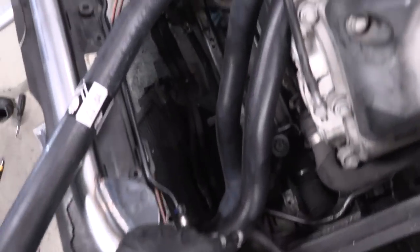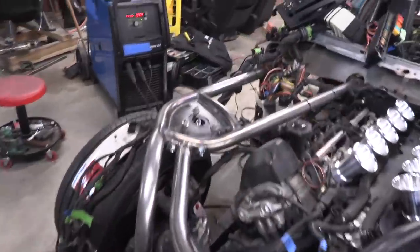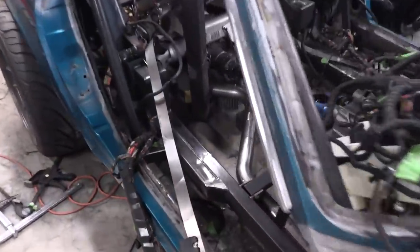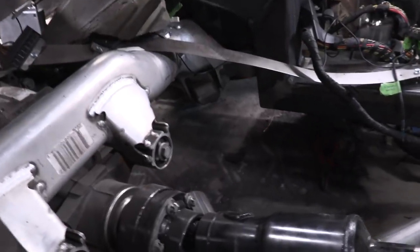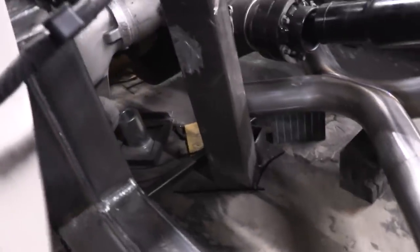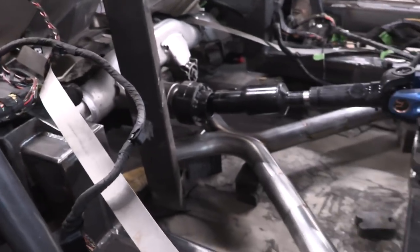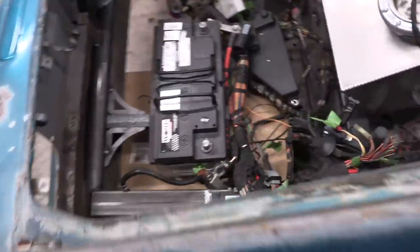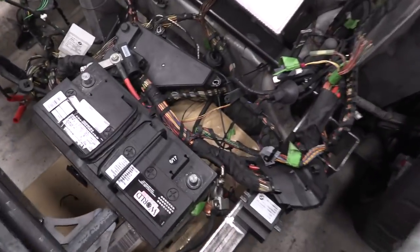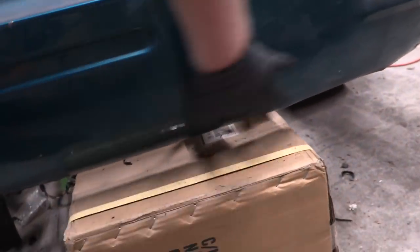Update time — I've got three hoses on now and I'm getting close to the fourth. I'm really not sure if that hose is going to work out, but we've got to make it work. Eric has got it tack welded up now through into the X-pipe. The next step is getting into the recessed area that the rear subframe has built for the exhaust to go through. Our resonators are going to need to go through there — from that, curve around, resonators back, and then a connection up to our mufflers coming out through here. We might not even be able to put the mufflers on today, but the mufflers are supposed to sit around where the car hasn't been cut up yet — we'll figure it out. Maybe we cut the car up today.